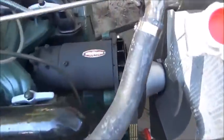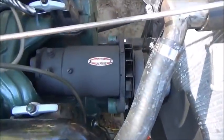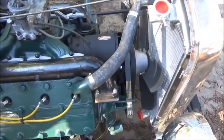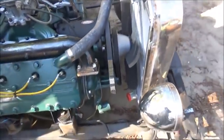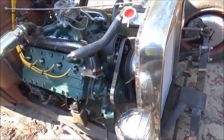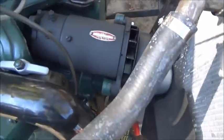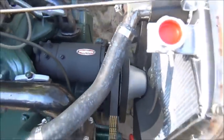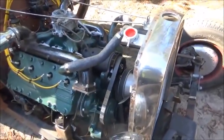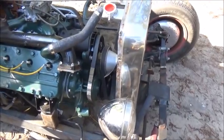And just so everybody knows, that generator is off of a 57 Chevrolet, and Jake, a friend of mine, brought me that. He's a subscriber and friend of mine. He's local, and I think he probably took it off of one of his 57s, and it worked out great because I was able to bolt that plate, the front plate, right on it. So now we've got a fully adjustable 12 volt Delco generator, just like was on it, except it's, like I said, 12 volt instead of a 6 volt. So I think we're good to go.